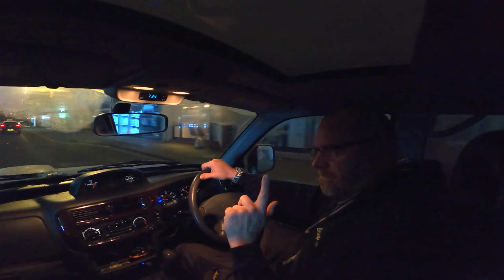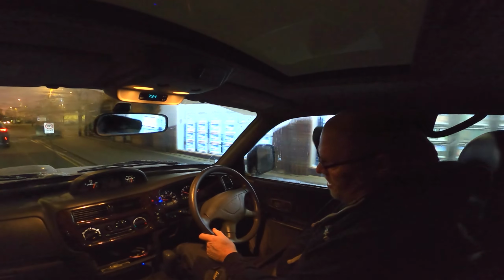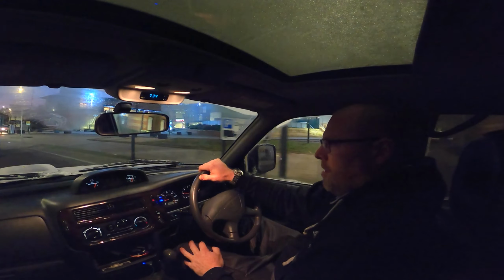Today I've got a Seat Ibiza coming in. Now this one is quite a strange beast, because what we've basically got is a factory radio in the center here. The radio itself looks like a single DIN, but underneath it, it's got switches for hazards, traction control, and an airbag warning jewel, like a light. In fitting a new radio, we're going to go double DIN. The double DIN pretty much takes up the edges of the fascia. So we are left with a problem, obviously, of where to relocate the buttons to.